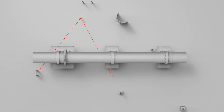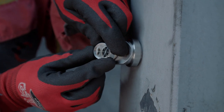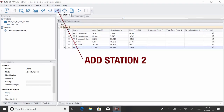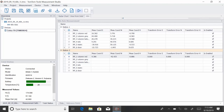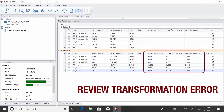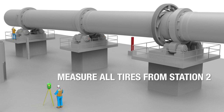Place the theodolite on station 2 — its second location — from where the tires and the reference points can be seen. Level the theodolite and adjust the reference points to the new position. Add a new station and select the reference points to be measured. Aim the theodolite to the first reference point and press start; the coordinates are displayed in the table. Continue until all reference points are measured. Review the transformation error of the individual points to ensure the second station can be precisely merged with the first. Then prepare the target axle and measure all tires from station 2 as done from station 1.